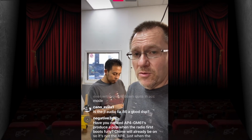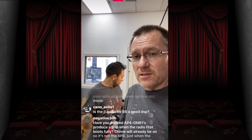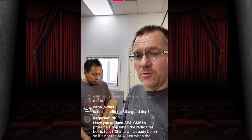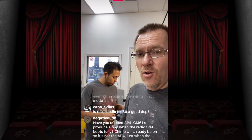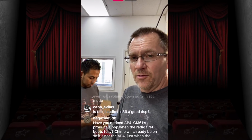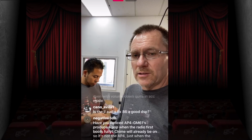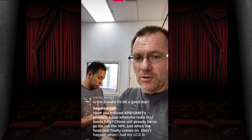So JL broke their DSP into two pieces. You have the Fix and you have the Tweak. The Fix is if you're going to go off of a factory radio or factory system and you need to be able to do summing and de-equalization. The Tweak is to go in as the DSP, your time alignment, your gain controls, and all those other fun things. So unlike most manufacturers that just give you one cool processor that does everything, they split it into two. And it is confusing, I will give you that.